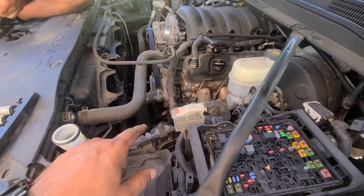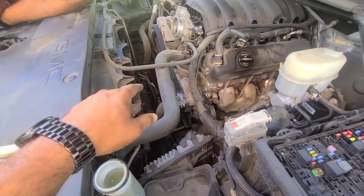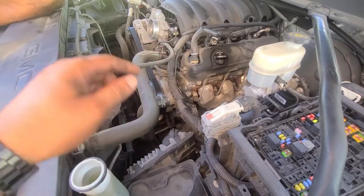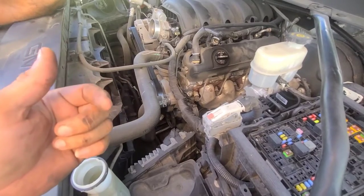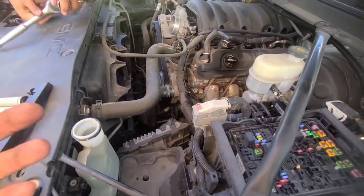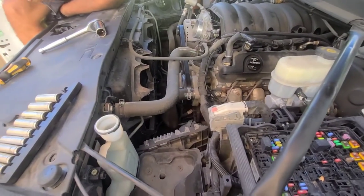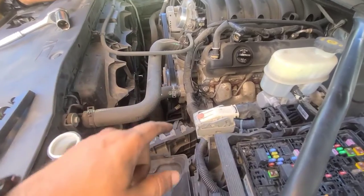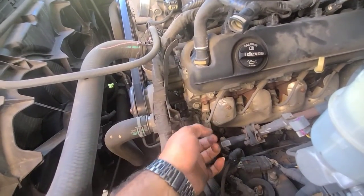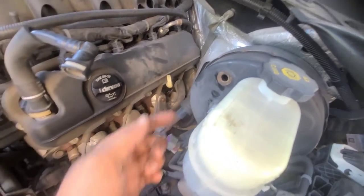What we're going to do is take the belt off the vacuum pump. To do that, we're going to turn the engine over with a flat head screwdriver on the belt so that we can spin it and take the belt off. It doesn't have a tensioner — it's just a self-tensioning belt, so she's really hard in there. We already took the line off; it has a little red clip to take it off, and from the booster itself you just pull it out.